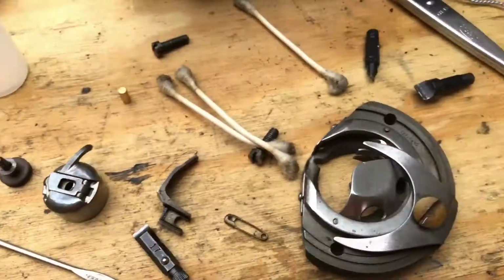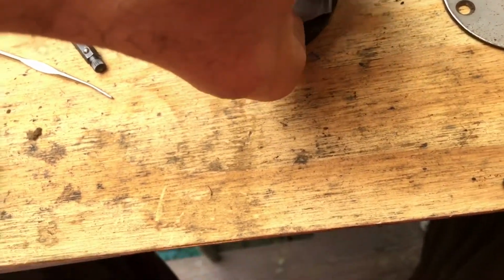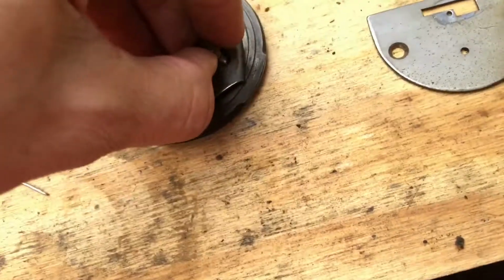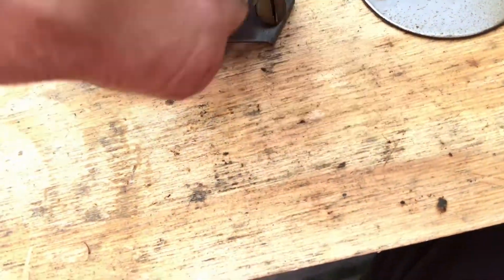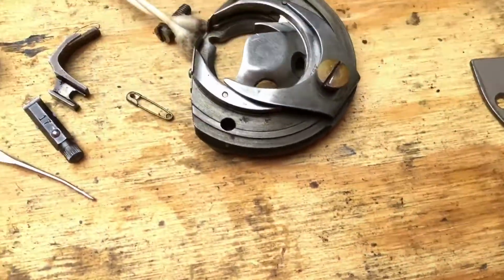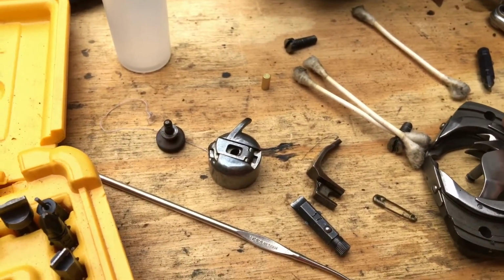There's oiling to do on a vintage machine, and I'm going to show that to you as we get closer to getting the machine ready to sew. But some of the things I'm doing here are to literally bring back a machine that has had no oil and lubrication. So I'm oiling some places that are not part of the normal maintenance of the sewer. And I'm also using, sometimes in the machine, larger quantities of sewing machine oil or lubricants than I normally would.